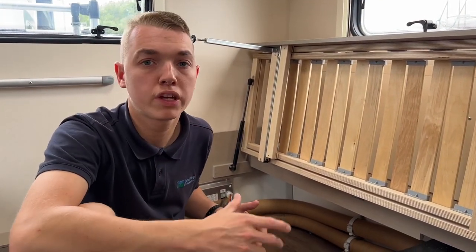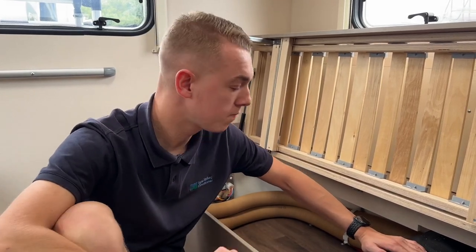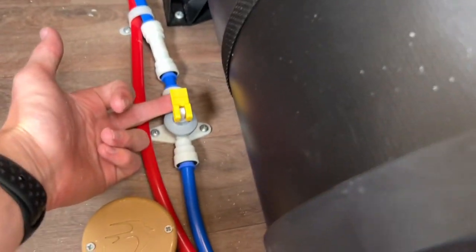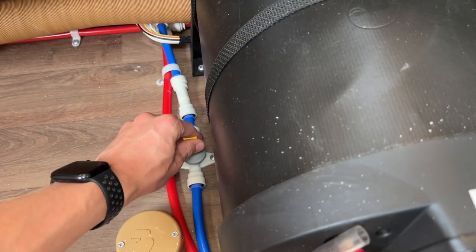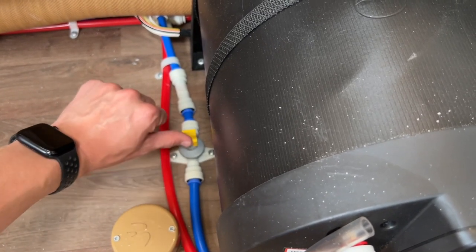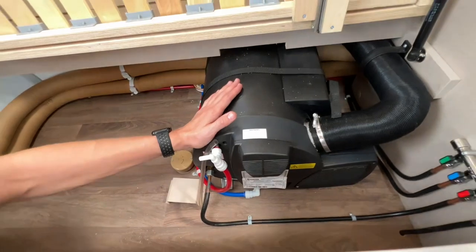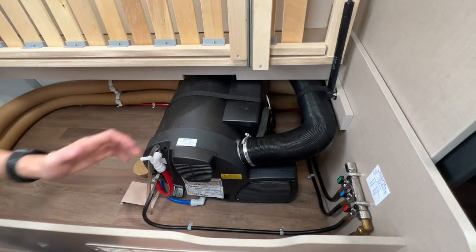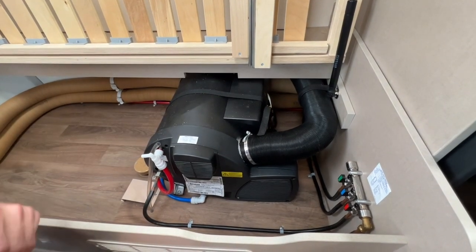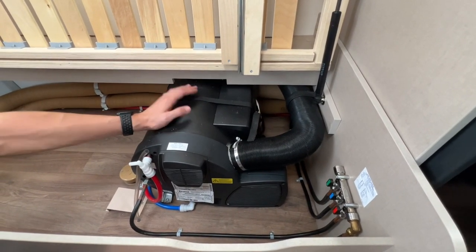To drain your boiler down in winter — it's very important that you do so because it holds 10 litres of water at any one time, fed off the pump from the fresh tank at the front. With the pump off, locate the yellow toggle, lift it up, and it will drain all 10 litres directly out underneath the van. Leave it up when not using the motorhome. When you come to reuse it, click it down, fill the fresh water, put the pump on, and go to the hot side of the tap — it will splutter as it's pushing air out and transferring water into the boiler. Once you get a pressurised flow, the boiler is full. Remember: if you don't drain it in winter, you could damage the boiler, which is very costly to repair and is not covered under warranty for frost damage — that is your responsibility.